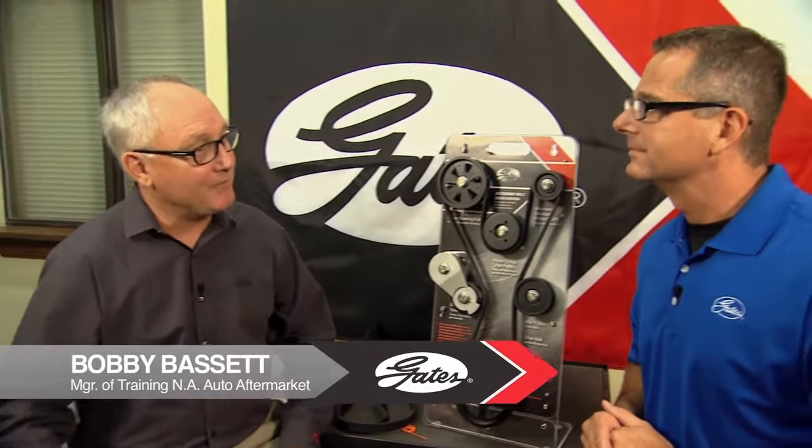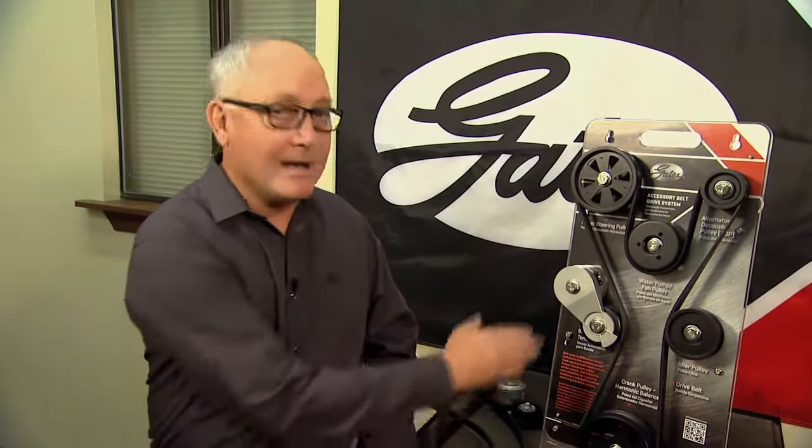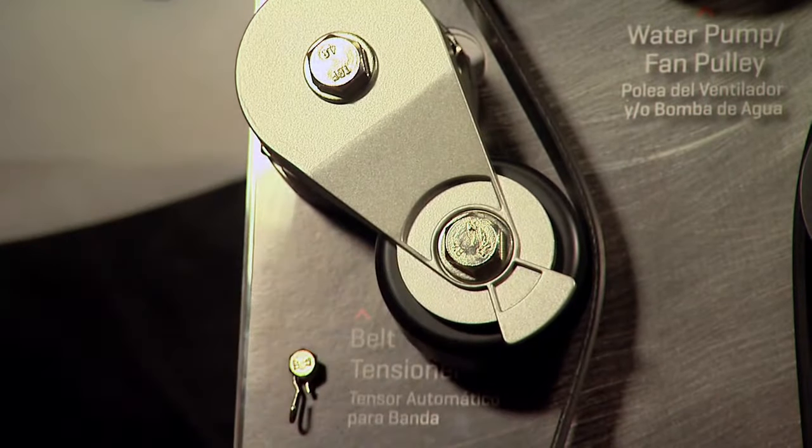You're the expert. Tell us a little bit about accessory belt drive systems. You know, John, before we get started, I'd like to ask you a question. Have you ever heard a belt squeal? Absolutely. You know, John, there's nothing wrong with the belt, but there is something wrong with the system, because today this is truly a system. And that problem is it's either from belt wear or from a failing tensioner. And that's what I'd like to do, is spend just a minute to talk about that today if possible.